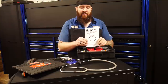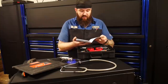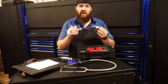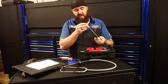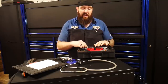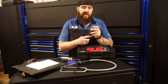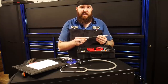There's also the owner's manual showing your warranty and how to use it in seven different languages — really useful if you don't know how to use the product. Getting into what is actually in the kit: it comes with one single spark plug adapter, what you'd use for a compression gauge set, except this one does not have any kind of one-way check valve. If you're going to be using this kit for testing things like the Chrysler 3.6-liter engines, they have a smaller thread and smaller diameter adapter — the compression gauge adapters will work, you just need to make sure you take out the one-way valve.